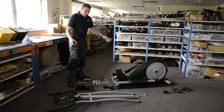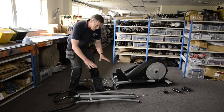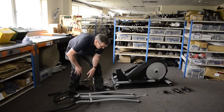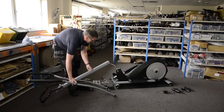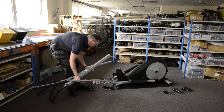I've already pre-assembled some of the parts. The column mast and the legs, for example — I've pre-assembled those; that's pretty straightforward, just follow the instructions. There's nothing too much to worry about there. But there is a care point when you come to bring this whole assembly to the main machine here — you can see how it all wants to move around, so you've got to be careful.